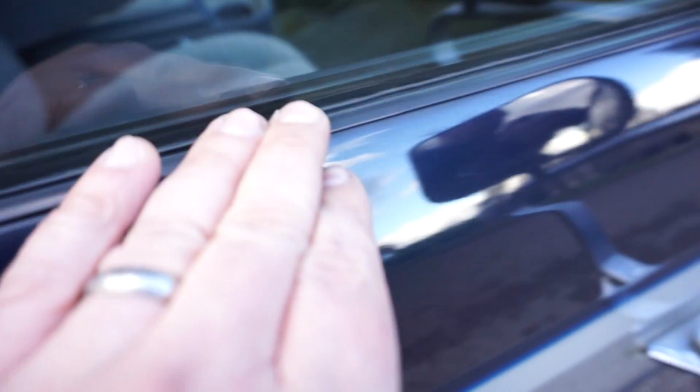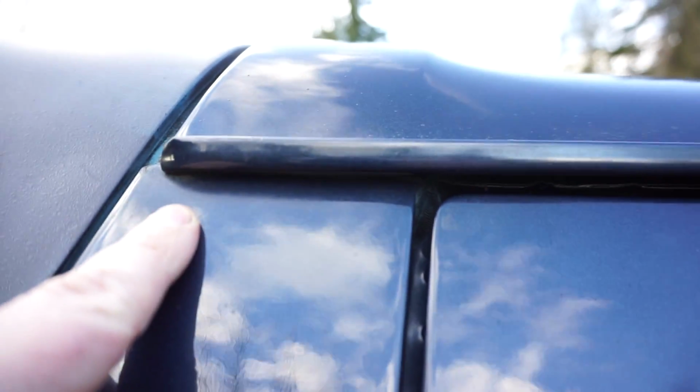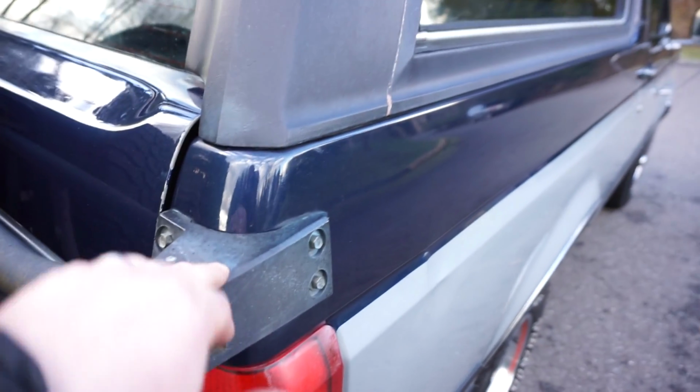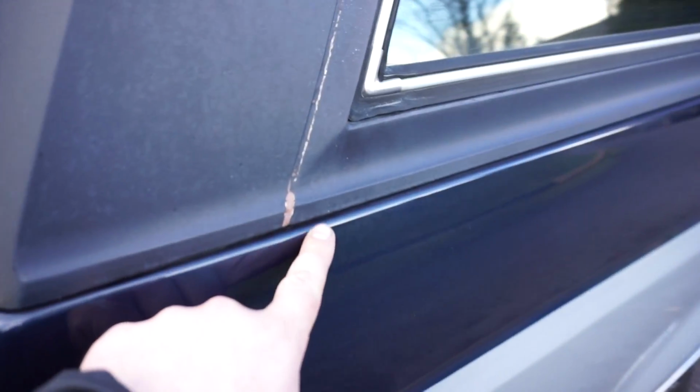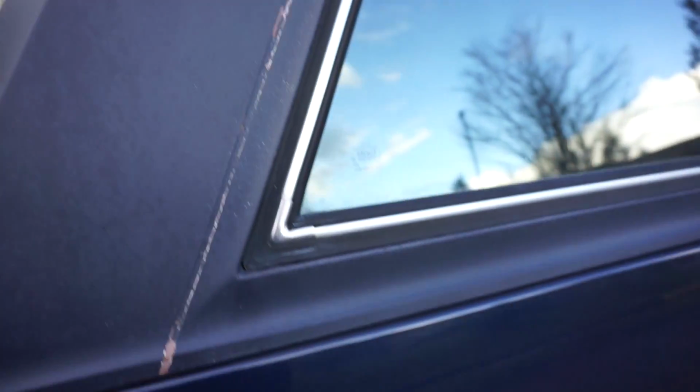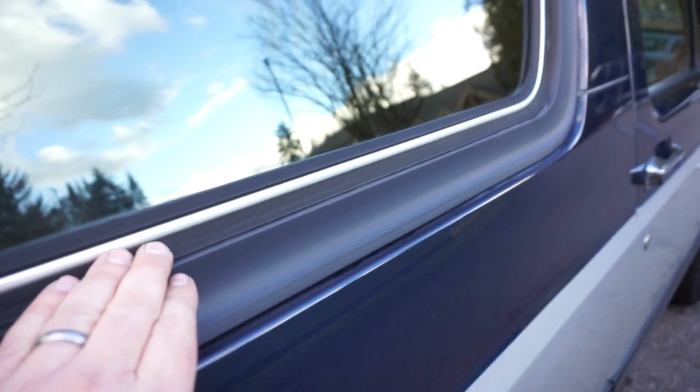Both door sweeps are a little bit dry and could use replacing. You don't have any bubbling or any pulling back of the paint there. Nice gutters, no stress cracks. And this truck looks really nice. It's nice to see the originality. It's a super dry, rust-free truck, really clean underneath. Top's never been off. You have a little bit of flaking of the paint in the seam sealer, which is really common. The rubbers around the window are in nice shape.